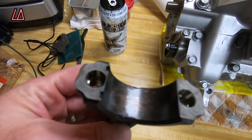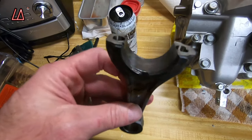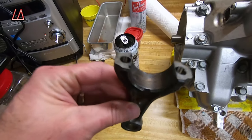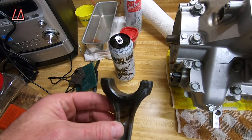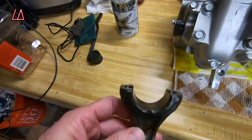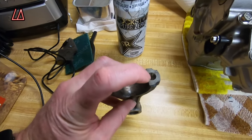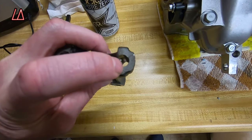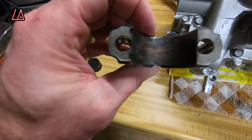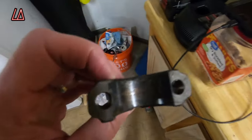What's kind of cool is when I got the new piston rod, they come as one piece. I'm looking at it and thinking — this is titanium, it's a pretty expensive piece. I didn't realize that you had to kind of tap it to break it in two, and then when it breaks in two you can see the break marks from the two pieces separating. And when you torque them down, the actual rod almost becomes one unit again. Kind of a cool little deal.